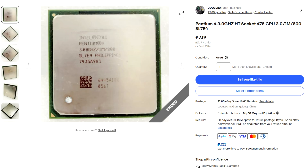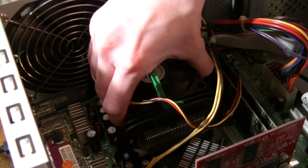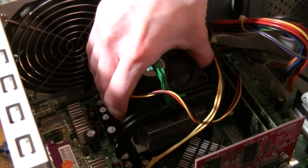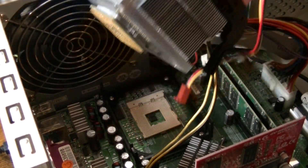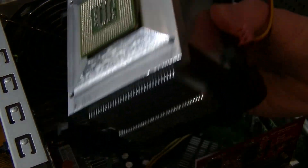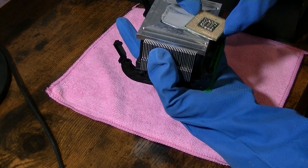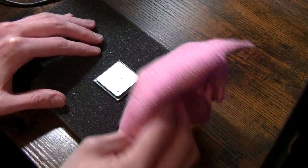At this point, I decided to use the refund money to purchase the Pentium 4 model SL7E4 that I had looked at previously — the same model as the original CPU. Of course, this was coming from China and I had to wait nearly two weeks for it to arrive. In the meantime, I got the heatsink detached once again, which also took the CPU with it just like previously. This further hinted towards a socket problem, but I was still going to try a different processor anyway just in case. I freed the processor from the heatsink without it flying across the room this time, and got everything cleaned up.